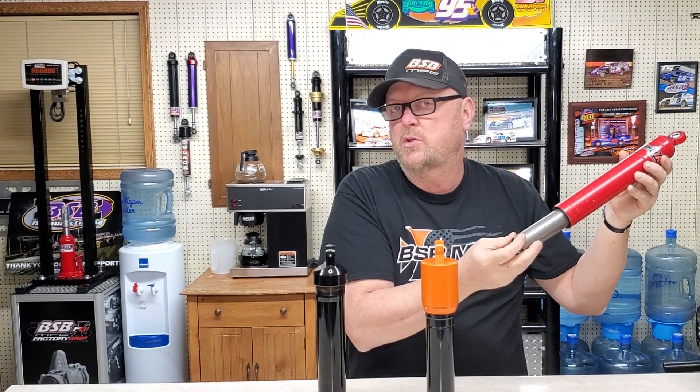I'm not a big fan of the twin tube shock — just never really liked them, really couldn't be competitive at building them, so we didn't go down that route. We build the gas shock. This is two of the styles that we build: this is a 20 series and this is a 25 series. There's also a 15 series. The difference here is the cap — on the 20 series it screws on the inside; this is a standard cap, not an expanded volume cap. It screws on, and this is a one-piece body with the divider housed inside.